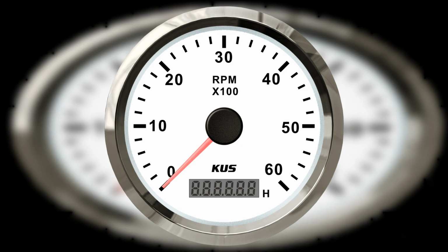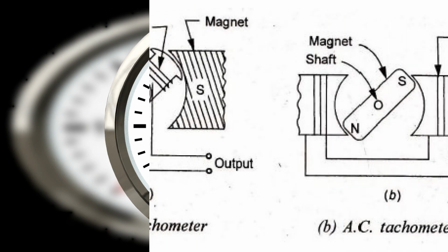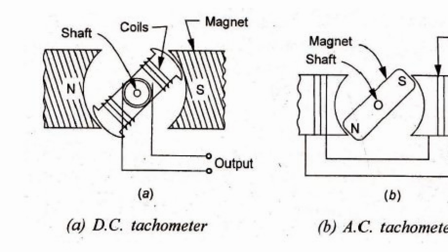Principle of operation and types. The tachometer takes the signal from the crankshaft speed pulse sensors and converts them into a corresponding numerical value. When using different methods of counting the reference value, direct, reverse, mixed, the error of readings reaches 100 to 500 RPM.